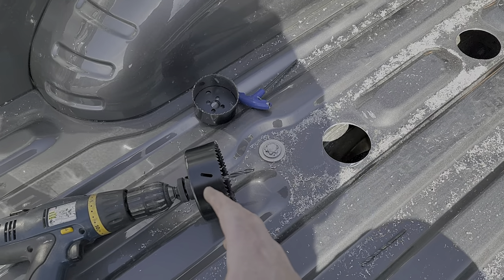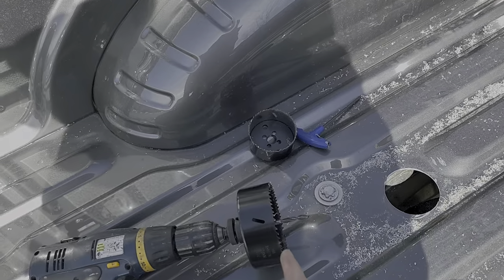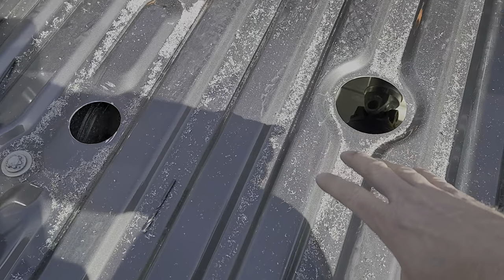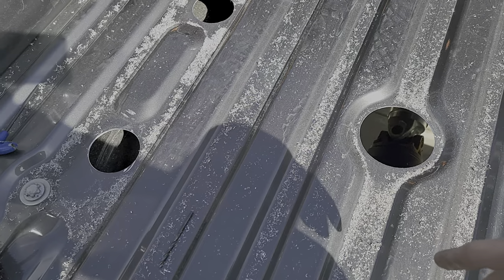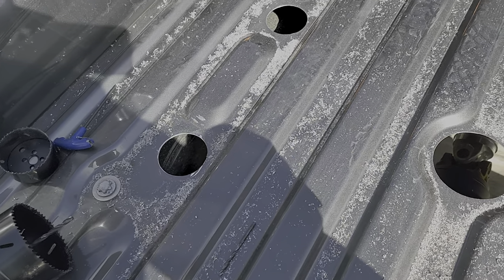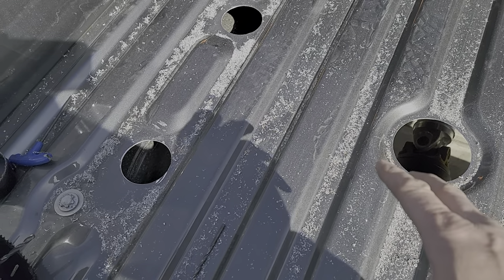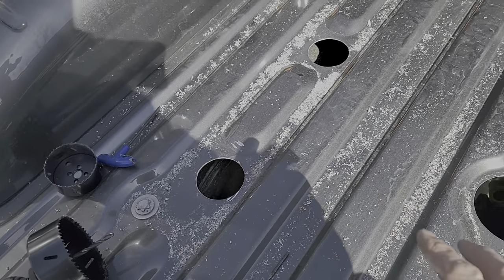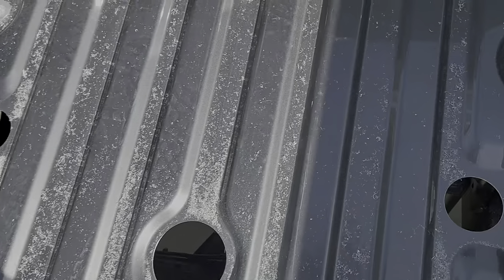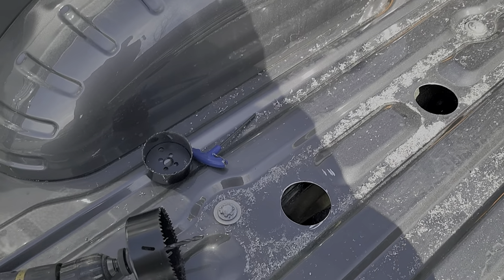We changed the arbor out, put the larger hole saw in, and we got all of our holes cut. These edges are sharp as all get out, so if you do buy some wear gloves, be really careful, and don't try to sweep these up — those can scratch the rest of your bed if you don't have a bed liner. Don't reach through the hole; if you need to grab something get it from the ground. Make sure you deburr them — you can use some emery cloth or a file. This is the first step to this OEM puck system, and once you put this in, this system is going to save you a lot of money, add good resale value to your vehicle, and it's just going to look really nice and finished. This will be a several part video, so we'll see you on the next one.